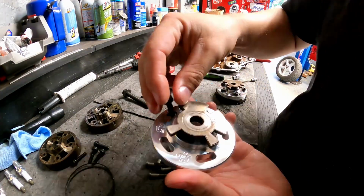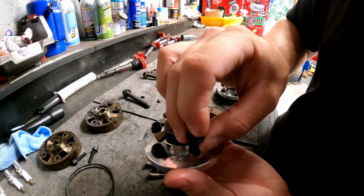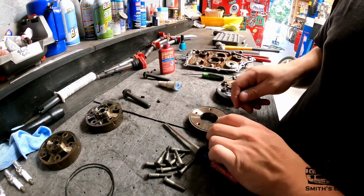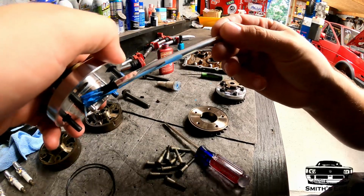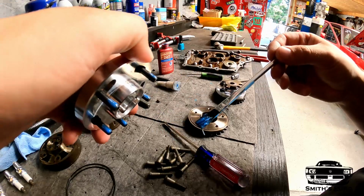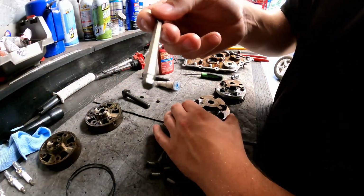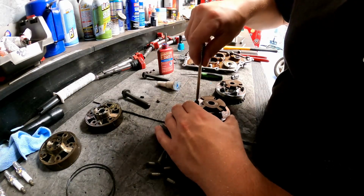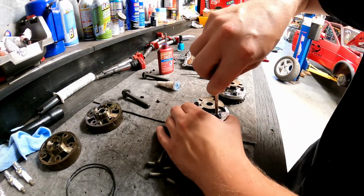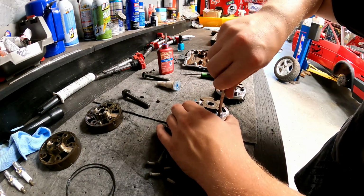Pull this off. I'm going to set all 5 of these bolts in place, but for right now, brush, whatever, and I'm just gonna douse them in Loctite. So at least there will be something on there. I know that at some point it had some. And then I use like a ball Allen and just start them one by one, because if you tighten one down, you're gonna have a bad time.